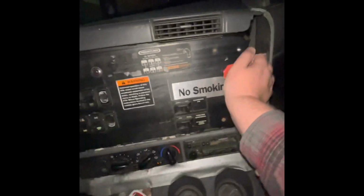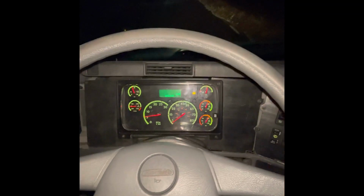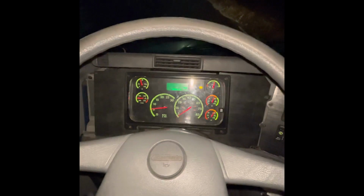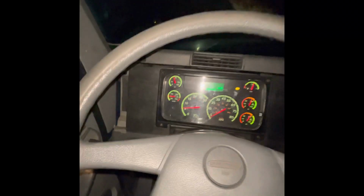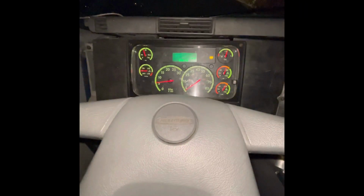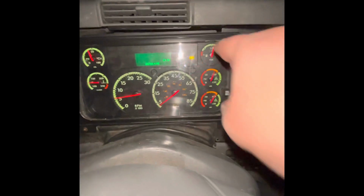2. Next I'm gonna push them both in and I'm testing my trailer handbrake. Make sure you have this down. 2 light tugs. 1, 2. Next, I'm gonna test my service brake pedal. Right here, this one that I'm hovering over. You want to make sure you have over 90 pounds of air.